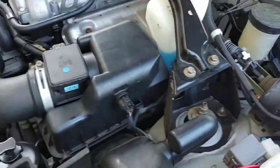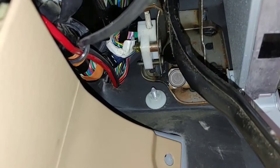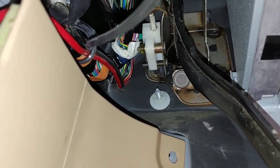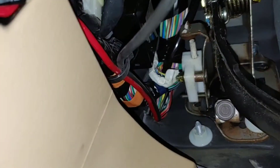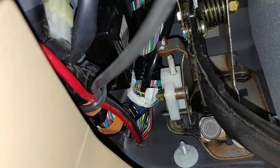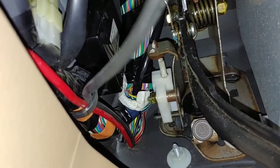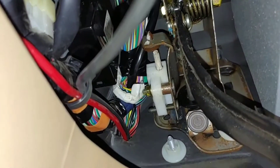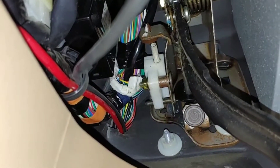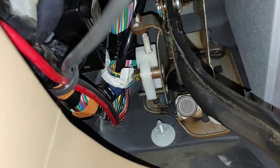Let me show you what it looks like from inside. There's the red wire — it was basically impossible to do by eye. So what I did is I followed this line right here — this is the hood latch line that goes up and goes through that harness. I used my hanger and pushed through from this side, and it punched a little hole in the grommet up there, which told me I was in the right place. That's the only way I could figure out how to do it. I didn't want to take out all the interior floor paneling, so I did it blind. I was gentle so I didn't rip up any wiring.